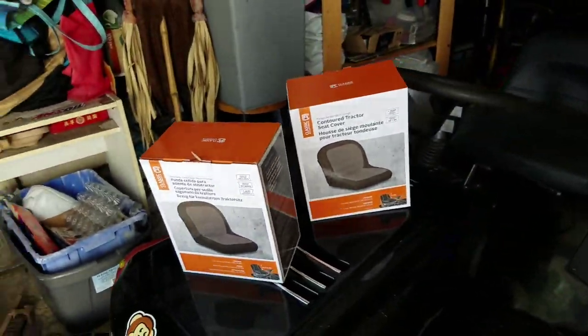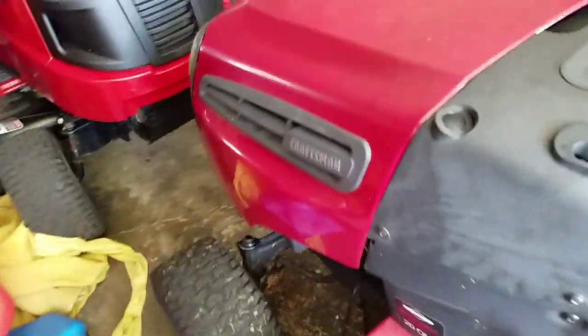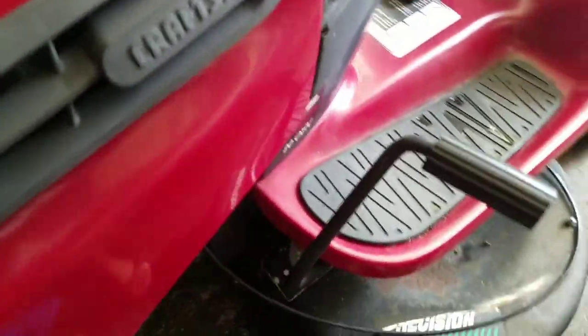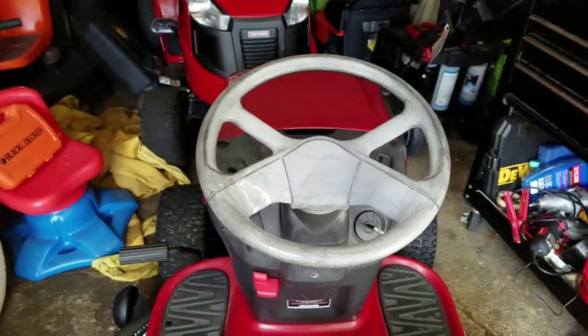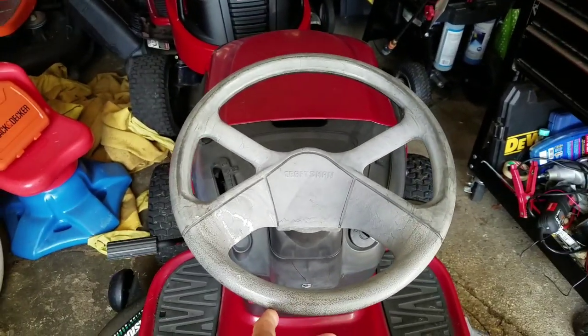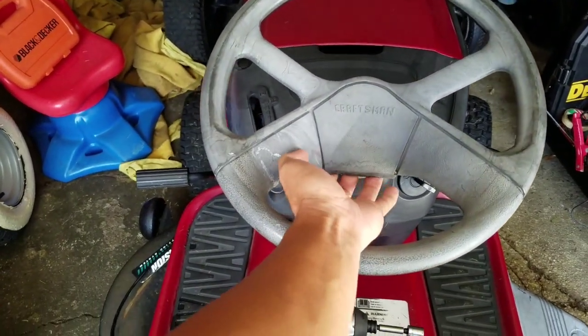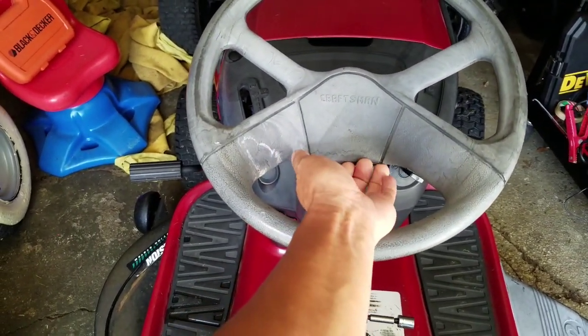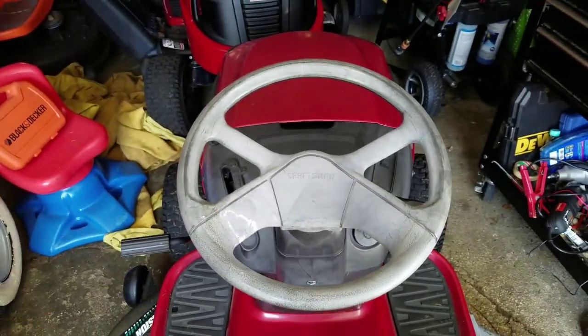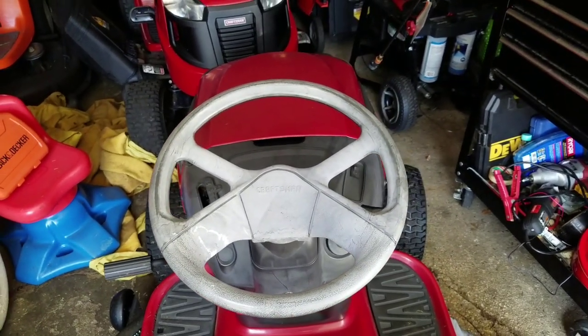I just showed you how to look up parts to get the exact right part. I'm not going to buy it for $30-40. From yesterday's video, Chris from Chris's Small Engines was giving me a hard time about the steering wheel not being lined up when going straight. So I fixed this for you, Chris — you basically just lift this cover here, there's a nut, undo the nut, take the whole steering wheel right off, line it up straight, and there you go.